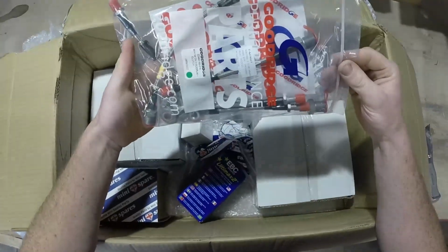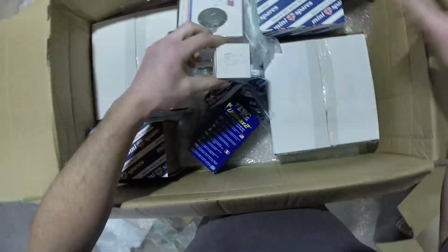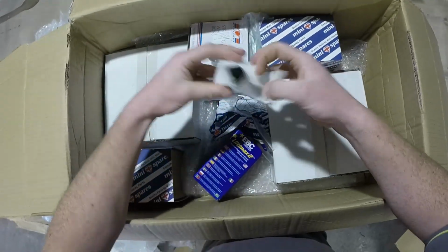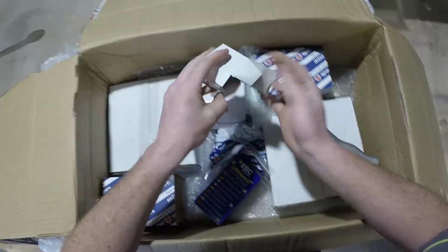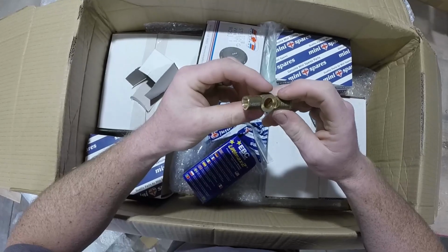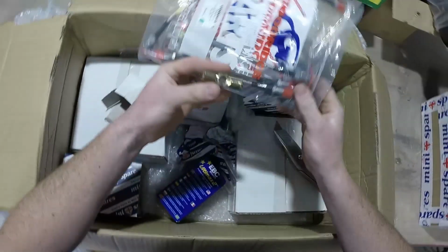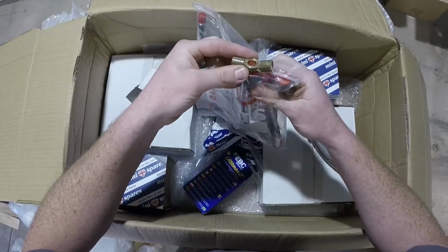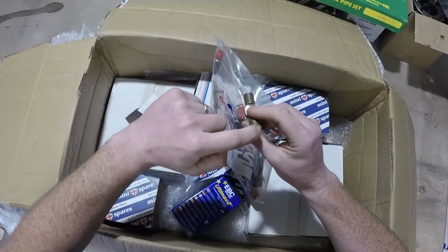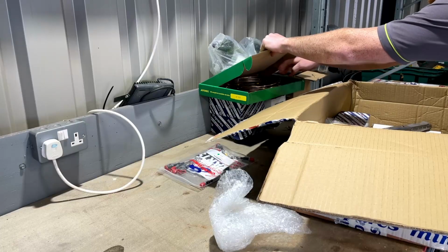More brake pipes. That's a full kit, front, rear, and there's a clutch hose in there. And also to do the brake pipes, I needed some of these little unions. So that goes onto your front subframe, and essentially what happens is your banjo bolt goes through there and goes into the top of your, that goes down to your brake caliper. Then one side goes up to your master cylinder, and that goes to the other side of the passenger. So there.